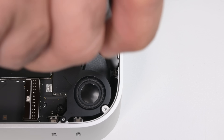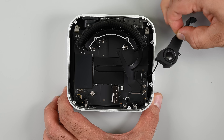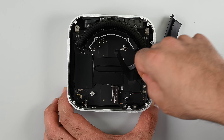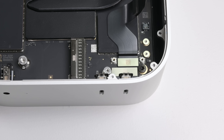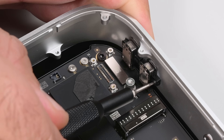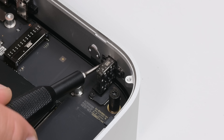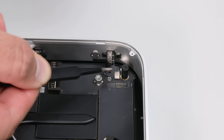It's now time to remove the speaker and figure out how to remove the logic board. The speaker is easy enough to deal with, but finding a path forward is a little less obvious — it looks like the modular front ports need to come out first. Removable and replaceable ports are great for repairability. These parts suffer from mechanical wear due to the constant plugging and unplugging of cables, so being able to replace them without having to desolder ports is fantastic.